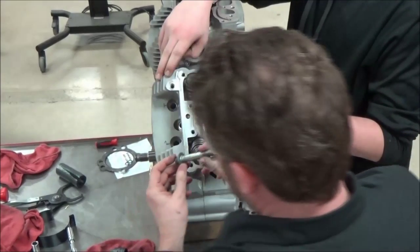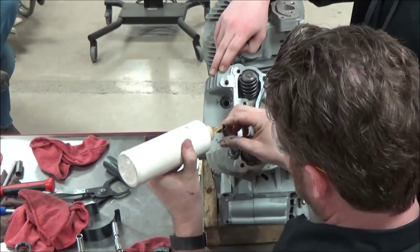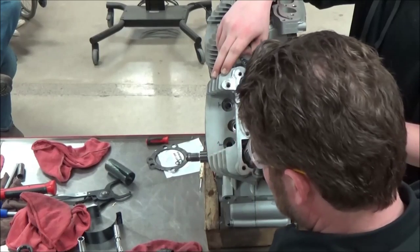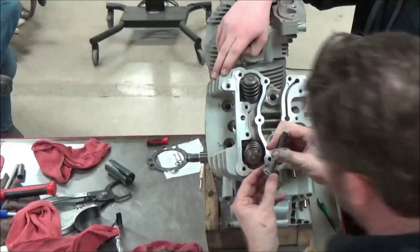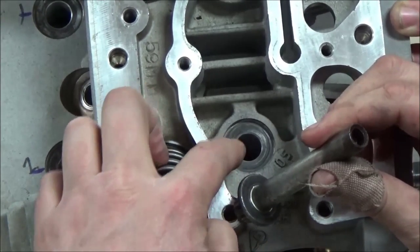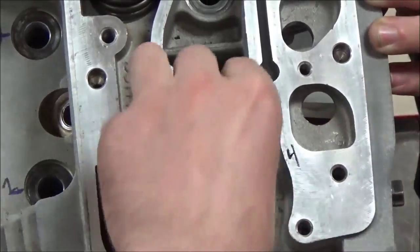Per the Harley-Davidson service manual, you want to take oil — you've seen this from our other videos about torque. You don't fill the cavity; you want just a very, very light amount of oil across the bolt. The manual also says to wipe off the excess — they don't want a ton on there. The oil allows the bolt to roll across that nicely machined surface. Go ahead and do that to all of them.